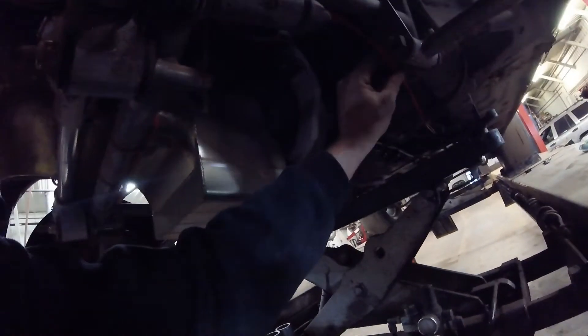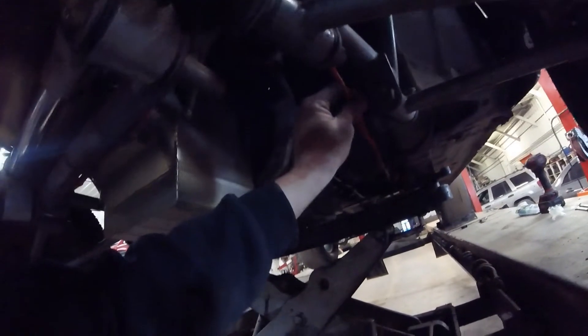Now we've got the dipstick tube all tightened up, re-routed a couple things. Now these are our wires for the alternator cutoff. We ran these from the back at the cutoff switch. We're going to come up here and tie into our alternator. This is a one-wire, but it's got a power wire and then there's a stator wire. The power wire comes right off the battery so that it starts up right away. We're just going to tap into that guy and go back to the switch, and then the other side will tie in here.